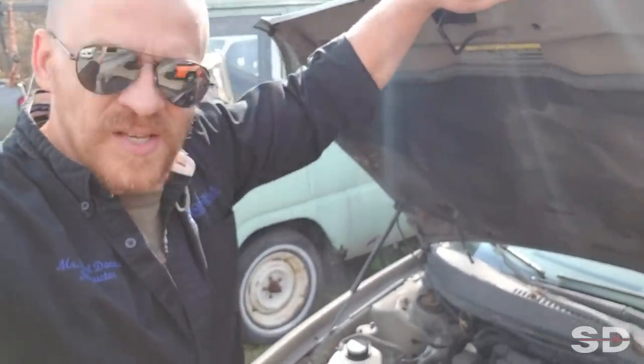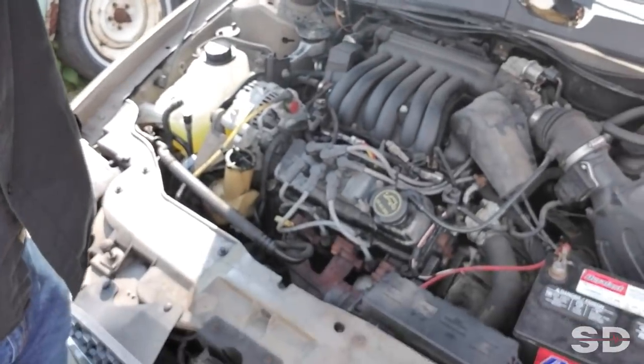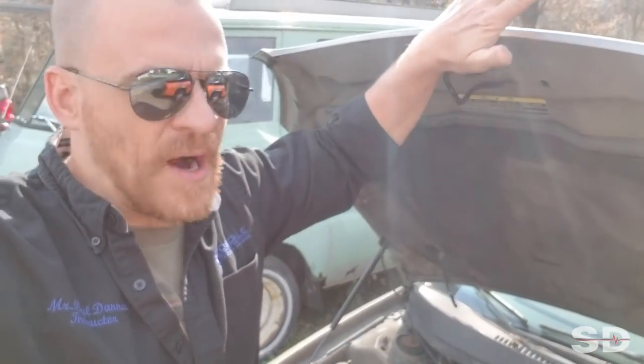Last comment about these Ford coil designs: I've seen them go bad — the coils themselves without open plug wires. It's just a bad design. Ford had all kinds of problems with these waste spark ignition coils. But make sure when you see half of a waste spark coil burned out, you have to make sure you don't have an open plug wire that caused that condition. I'm going to link a video in the description on a Chrysler I did that had a burnt coil pack like this one — half of it — and when we were done, we found an open plug wire on that side that had the burned out coil.